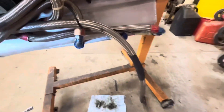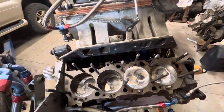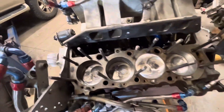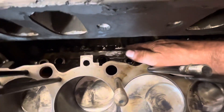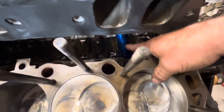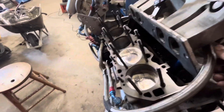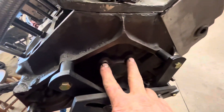All the oil that drains into the pan gets sucked out through these two stages. In the early days of pro stock, they had so much trouble keeping valve springs in these things — they were good for one or two passes and you'd have a broken spring almost every time, and after 10 passes you were done with the springs. So I got the brilliant idea of completely covering the valley with epoxy, except at the very front so the oil can drain back when you're under braking. Then I put in this blue pickup tube.